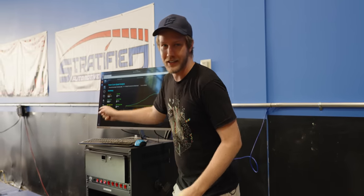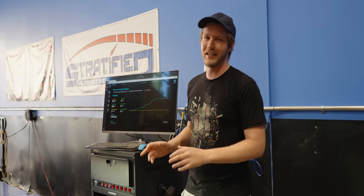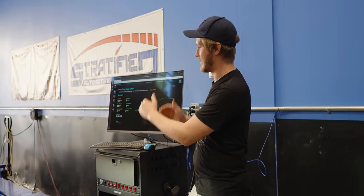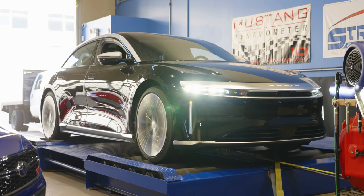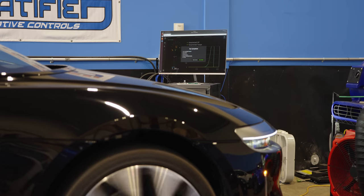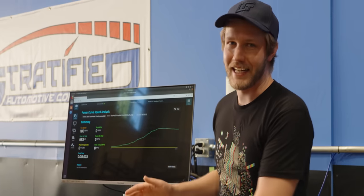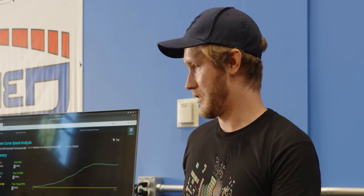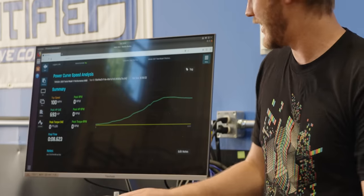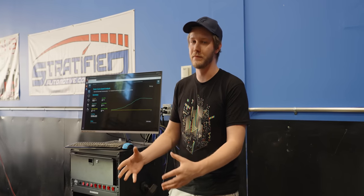Our final result is 693 horsepower. Now you might be thinking that's low, but it's actually pretty fine. The issue is load calibration — normally in a gasoline car you'd take it up to speed, put it in neutral, let it slow down and put that into your calculations. We can't do that here because we can't turn off regenerative braking. They estimate this actually translates to 790 horsepower, which is very close to what it's rated, especially given we didn't have it wide open until 40–50 miles per hour, and electric cars have their most power down at zero.